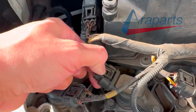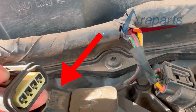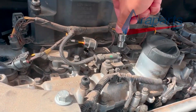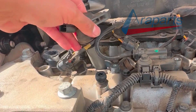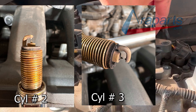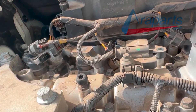What you can do instead is unplug the primary or low voltage side of the ignition coil. What I'm going to do is swap cylinders number 2 and 3 ignition coils and spark plugs, then check on my scanner to see if that misfire followed the ignition coil and spark plug. My scanner pulls up live misfires — if yours doesn't, just erase the check engine light, wait for it to turn back on, and see if that misfire code followed that ignition coil and spark plug.